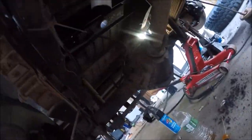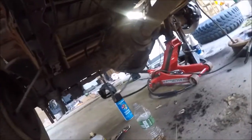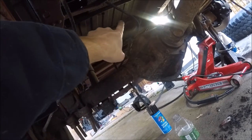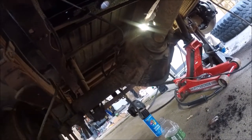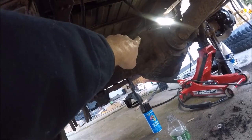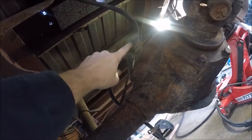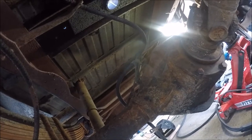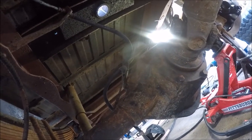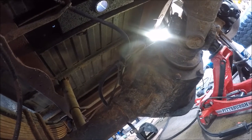That's probably about all I'm going to get out of this whole project today. But other than that it's more or less done. The only thing I'm going to have to do, once I get all this mess out of here, is put my new soft center hose in right here, and just run the hard lines out to the ends of both the other brake hoses. It should be no more than a foot or so on each side — even less on this side because the tee actually comes down the center brake hose. I've got like a six-foot long piece of hard line in there, and that'll be more than enough. This project's coming right along. Won't get it done today like I was hoping, but that's not really a surprise.